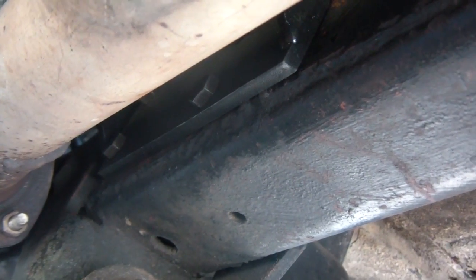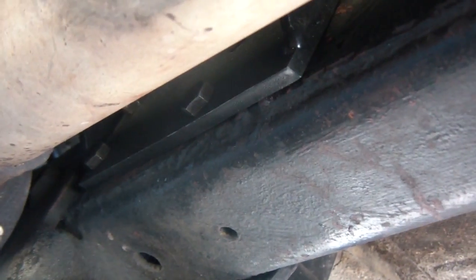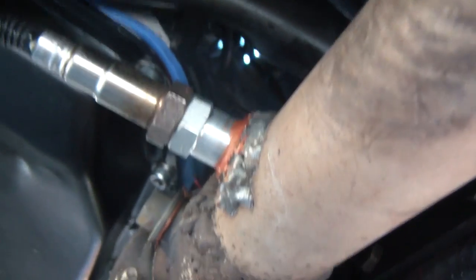Here's what I was talking about — this is the little O2 sensor extension. I had it drilled out so the sensor would actually fit. I'm going to bring the cable up a little closer to the exhaust pipe. Originally I was routing through a different area and I noticed a small transmission line leak here that I need to tighten up.